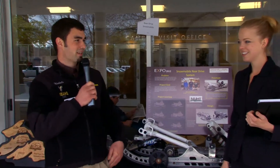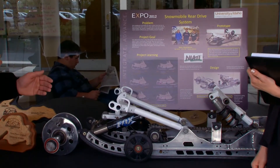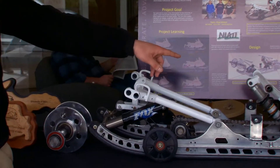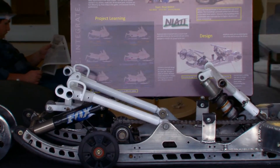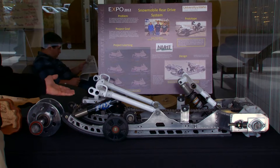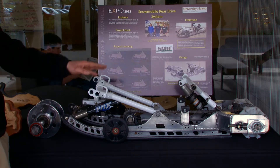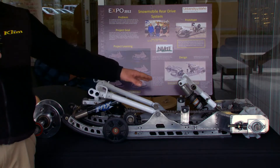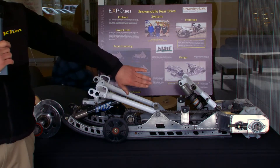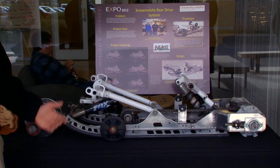I'm Jeremy Nichols. There were two other team members: Chris Hill and Neil Miller. We designed a rear drive system that would be a bolt-in design for a stock snowmobile. Typically the rear drivers are located on the front of the drive shaft, and when you drive, you send the slack side of your track through the bottom of the skid, which doesn't make a lot of sense. When we moved it to the rear, you actually send your tension side of the track on your drive surface of the skid. With that you gain performance, handling performance, and fuel efficiency.